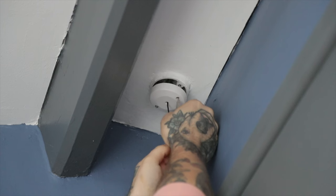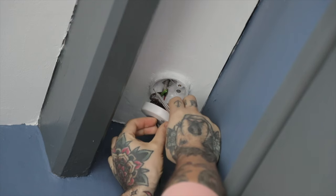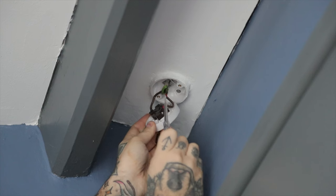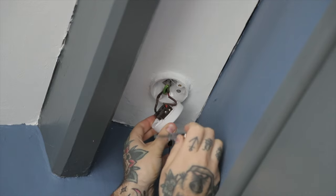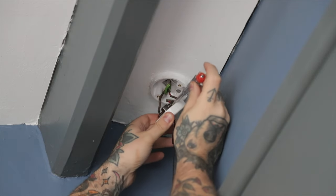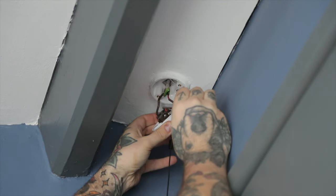This light switch has broken — well, the pull cord has broken before, so it's not the first time this has happened. What you can see here is this red cable — because this is old wiring, it would be brown potentially on yours. This red cable is the live. So what I'm going to do is just touch the terminal with this screwdriver and then touch the end, and if it lights up there's still power. But because we've switched the breaker off there shouldn't be any. I touch the end — nothing lights up, so that wire is completely safe.